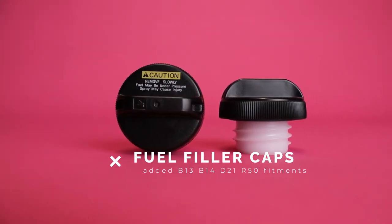One piece of bad news: the clip that holds the prop rod in the original style is not available anymore. We're hoping to figure out a substitute — if you have a B13 with that clip, shoot us a picture and we'll see what we can make do. Also: gas caps. They use two different part numbers, probably one federal, one California — or one vented, one non-vented. It's very important to shoot us your VIN so we make sure you order the right one. A wrong cap can do all kinds of damage to your tank.